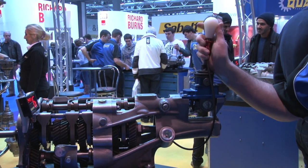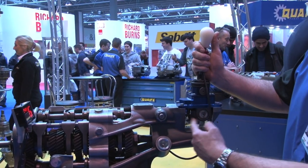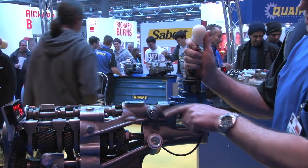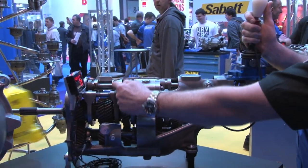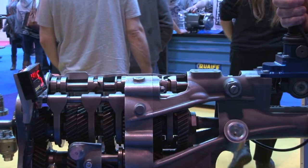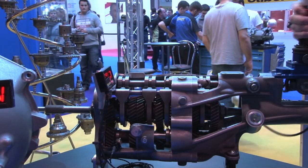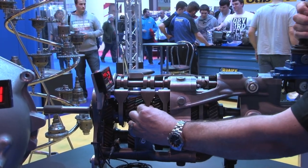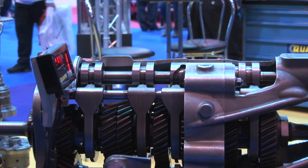We have six gears, and by pushing the gear lever, a ratchet arm in here rotates this drum and the forks follow the track and select the gear. By pushing the gear lever forward we go down the gearbox, and these forks via that pin just follow the track. It's a very simple operation.